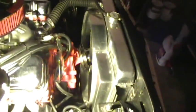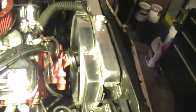I knew it would be some kind of fun like this. I'm going to get it, you just wait. All right, here we go. See what I tell you, take the radiator out, set it aside, and you can get that fan on there. Now I've got to tighten it up, put that shroud back up, put the radiator back down in here, and tuck some wires up while I'm at it. Might as well do a little maintenance while I'm at it.